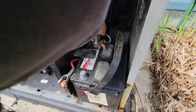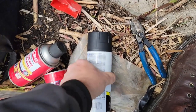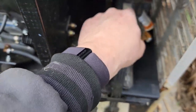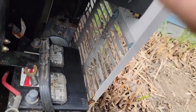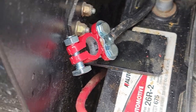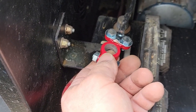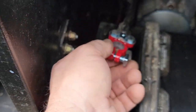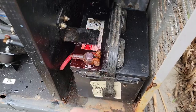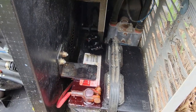All I had is a red terminal for positive - looks like it'll fit just fine. I've got some spray paint, we'll go ahead and paint it black. Let's chop that old one out of there. Got it clamped down about as good as you're gonna get it. I'm not going to spray it in advance because I don't want paint in between my terminal and the clamp - I'll spray it once I've got it on there. Got that on there, got the red protector stuff on there, then got the other one painted. Doesn't look too bad.